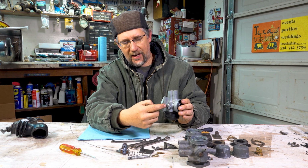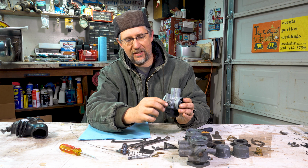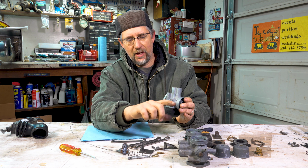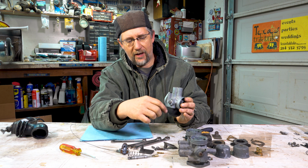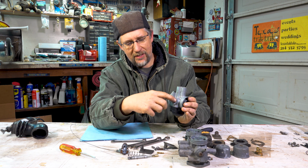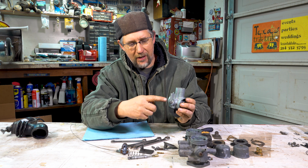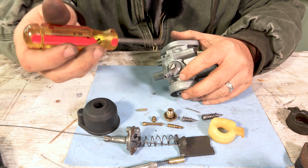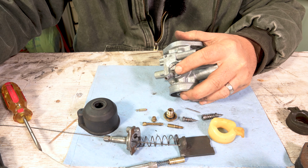All right, this side where your gas fuel line was running to, which I forgot to mention, that's the other thing you'll have to pull off from the truck. And you want to clamp that off so you don't have gas flowing before you pull that off. Some people call this little mechanism the banjo. I don't know why it's called a banjo. That's just what people call it. But it has a flathead, or you can use the wrench, either one, to take that off.